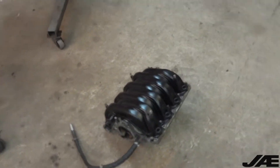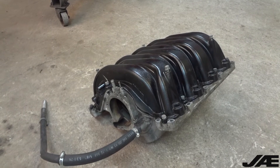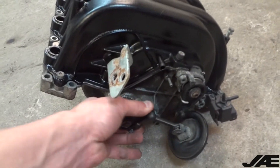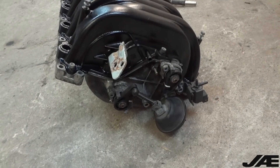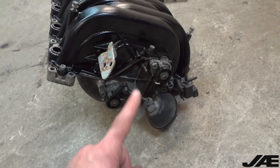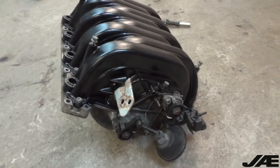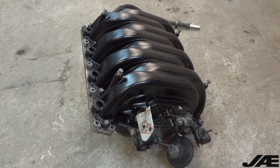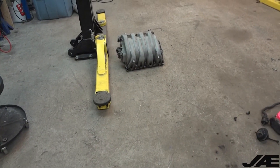The intake manifold is not on because I've actually had to rebuild it out of two other ones that I had. None of the three total manifolds ended up being completely good, so thankfully I was able to get enough parts off the ones I had to have a fully functioning manifold with intake flaps. I have the other vacuum pod right there just waiting — I was waiting for the gasket sealer to dry before I torque that down. This unfortunately is just spray painted for now. The coating from the factory is some super hard enamel so it wasn't easy to strip, and I just didn't want to waste any more time on it. It'll probably get swapped out with another cover from one of my other manifolds.